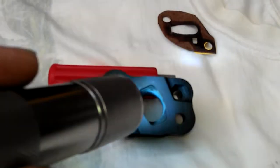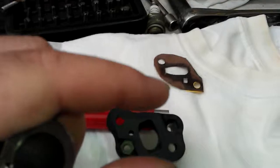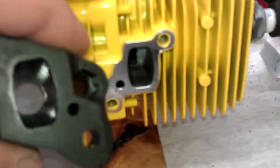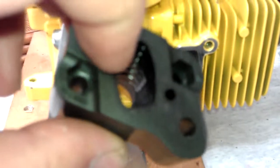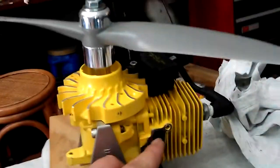If you look at the oblong shape of this port, it's shaped kind of funky — you see a lot of deviation there — but there's really nothing you can do about it because the way that goes straight in then it twists some and goes into the engine. Now if you look at the port that's on the engine here, you can see the port shape on there is exactly the same between the two. The manifold on this side where you're going to your jug is absolutely perfect. You can see there's ridges in there — that's from the tooling process where it runs through the CNC machine. It makes like a step, then a step down, another step down as it's closing the sides of the port, but it is matched 100% from this port on the motor to this port on your manifold.